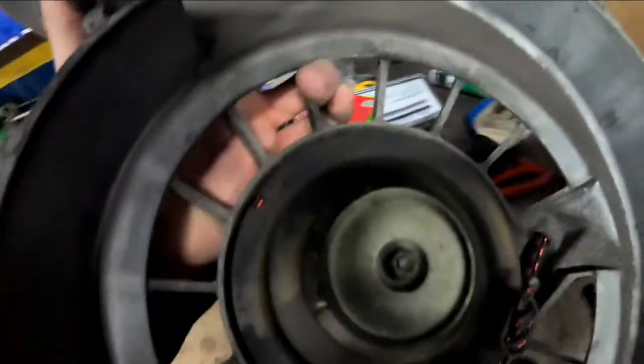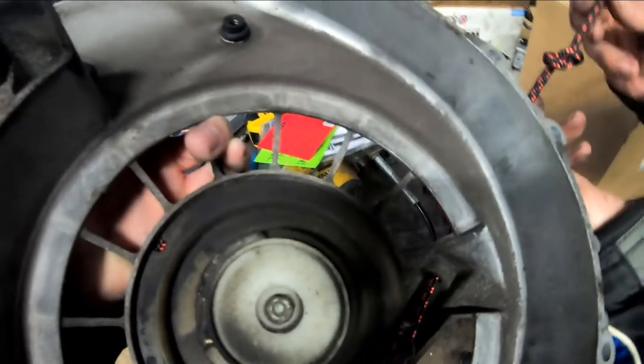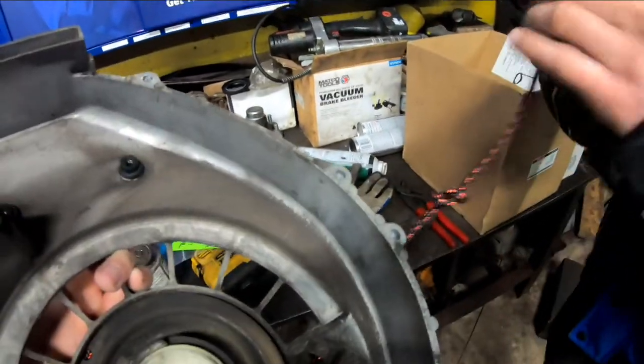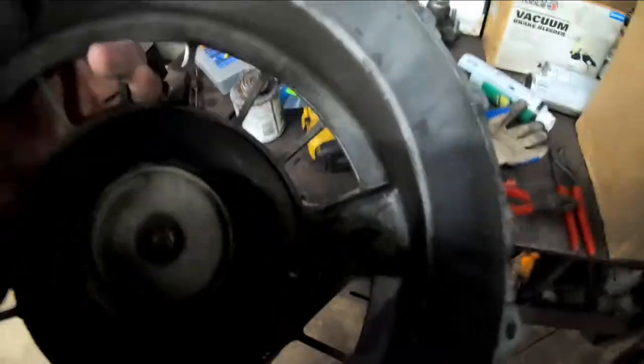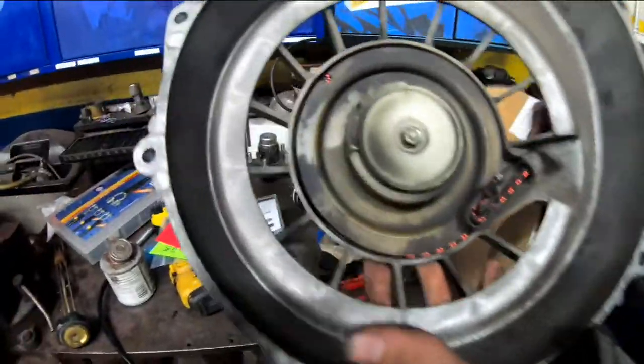This recoil rope — I'll try to find an Amazon link. I got this in a six-pack on eBay for cheap, and this stuff's really good quality. It seems like it's braided, they got the ends nicely melted so it won't fray. The general rule of thumb is most recoils all operate the same, but Ski-Doos are a little funky — they have an eccentric drive. Polaris and Yamaha use this dog style. Other than that, that should be it.